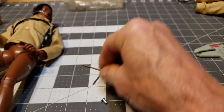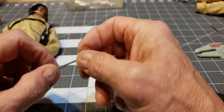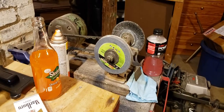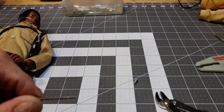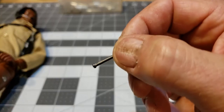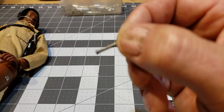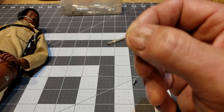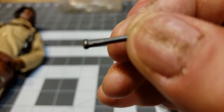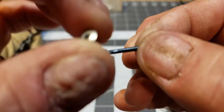What you do is take one of the center pins and use a file, a grinding wheel, or an electric wire brush like I've got here, and just smooth them out real good. You'll see they have a little indentation on them, so you just grind that down a little bit so that you can slide the outer half over it again very easily.